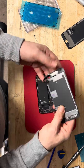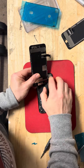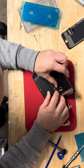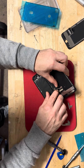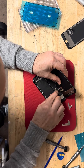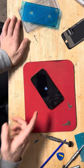Now you bring the phone like this and connect this one first — do it opposite so it will be easy to connect. You have to feel it, and when you feel it you just press it. You have two here, same way — you have to feel it and press. All right, the second one is in. Put the battery, close it, and hold the power button for six seconds.